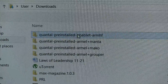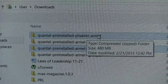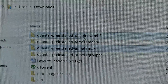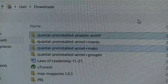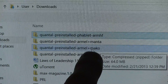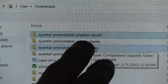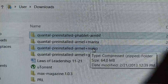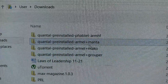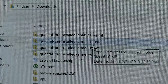All you're going to have to do is transfer both files over to your device. I have Mako which is the Nexus 4, so I need to transfer the phablet file — which is the main one — along with my specific device file. So two zip files transferred over to the internal storage of my device. This file specifically is going to be different depending on which device you do have. The phablet file is going to be the same for everyone. Make sure you download the correct one — if you need help with this, just leave a comment and let me know.